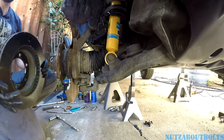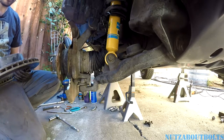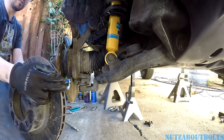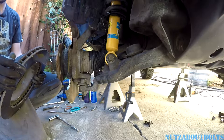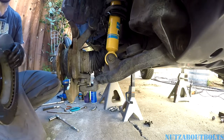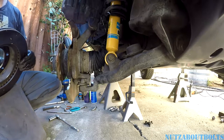Now the rotor's free — wimpy little skinny rotor. These are actually brand new, or almost brand new rotors. I noticed that these thin rotors — you can feel them warping when they heat up. I read about this online and it turned out to be true. I was going down a hill, they heated up, they started pulsating, and then they cooled down and went back to normal.